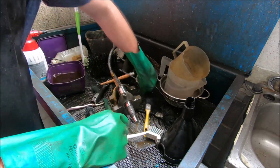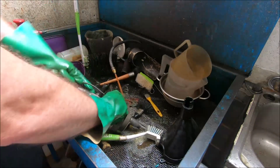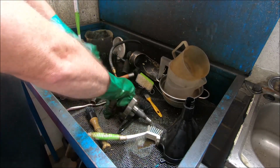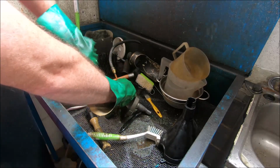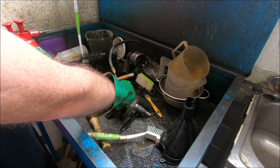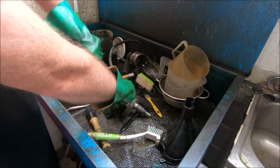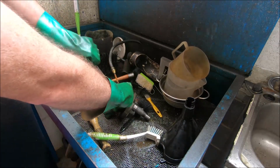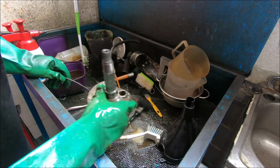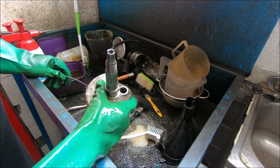Get inside the big end hole with the brushes and see what comes out. I think it's clean enough, but you probably won't really see anything come out of it. I did one last week where, when I was brake cleaning and spraying it out and then blowing it out with the air, you could see a little bit of grey residue coming out, which meant there was still some clay in there. But if they've been run on synthetic oils, you probably won't see too much of that. Traditionally that's a mineral oil thing. If it's got mineral oil in it, then there's just still some dirt in the oil.